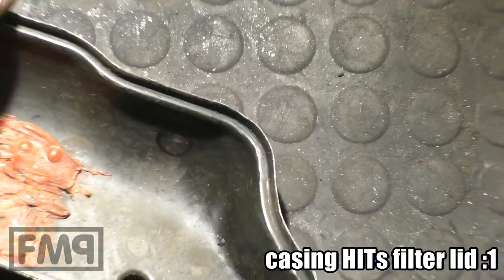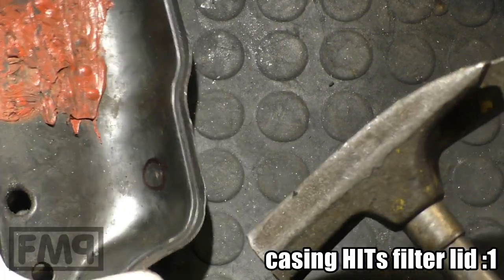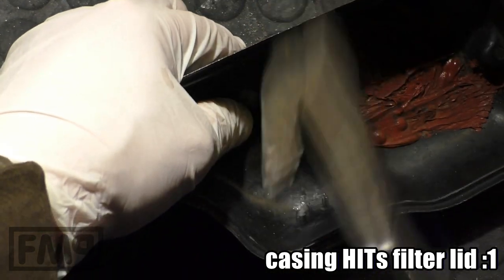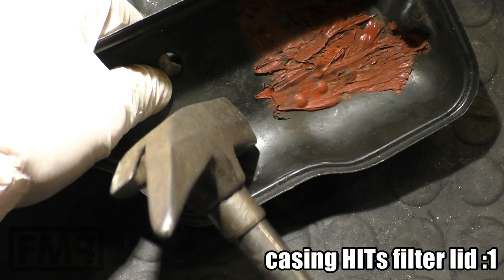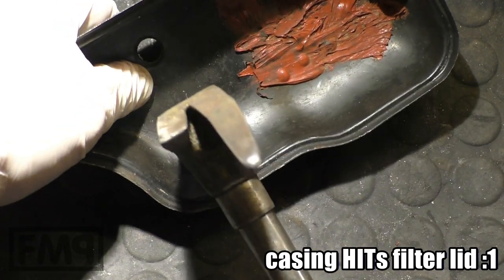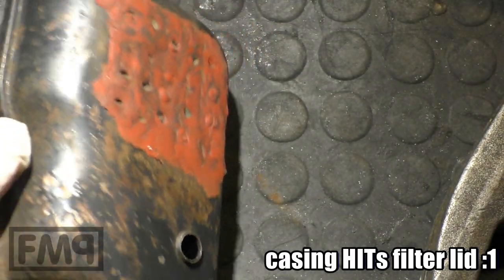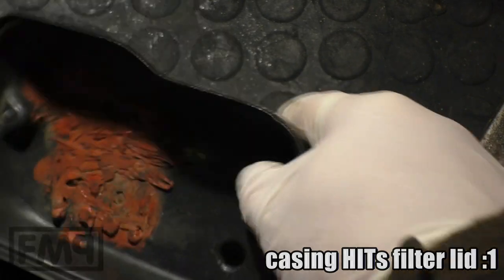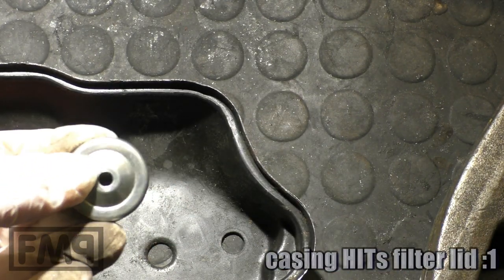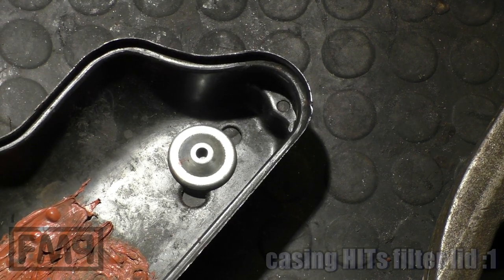How can you solve it? And this was just part one. I will show you the second part of the bungling in a second. You just take a hammer and make more space, because who cares what it looks like under the lid. The most important thing is that it can start your warm engine. Nothing more annoying, even if you have no electric start, when the engine is not starting anymore. Just hammer it and make space here so that these two parts cannot touch each other. Check the parts, you will mostly find these marks, and they are actually causing the flooded, drowned engine symptom of Vespa carburetors. But that was just part one.